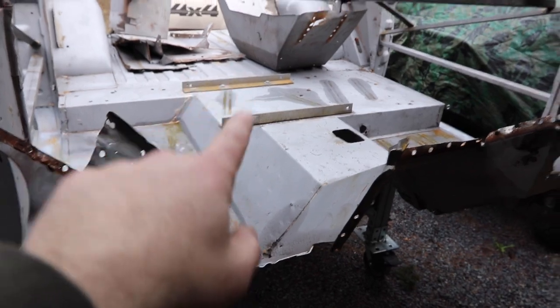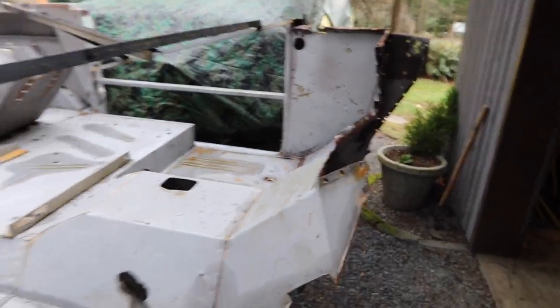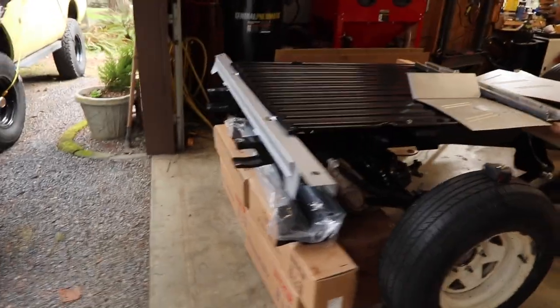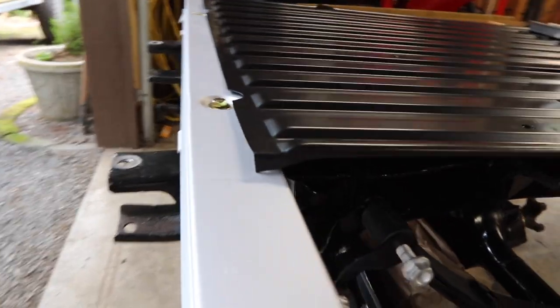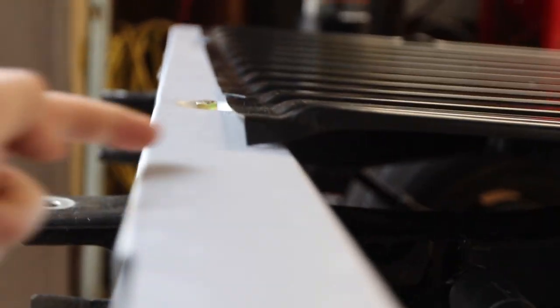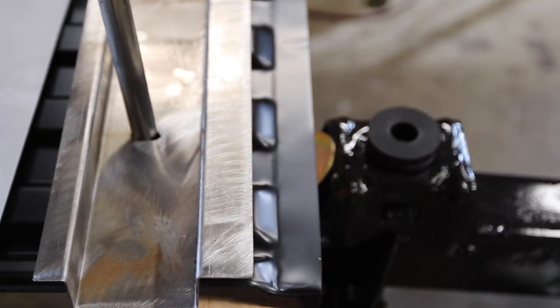Then the top of the firewall here — that piece is like 60 bucks, so it was in good shape and worth cutting out and reusing. I was planning on reusing the cowl but those were mangled, so I couldn't get them out without mangling the body. So I'm just mocking stuff up. You'll see little details here — like it doesn't sit flush because this has a lip, so I just got to notch that so it sits down and figure out the right distance back. I've got my four pieces here.